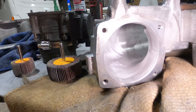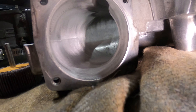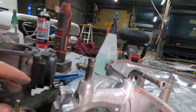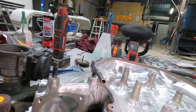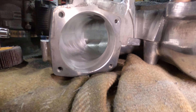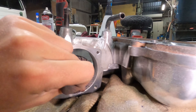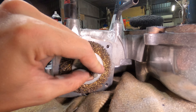There's a little cast line on the left side of that throttle body — it's upside down so it's actually the right side — and that's what I'm trying to work on right now. The rest of it is getting pretty smooth, barely any casting bits left. It's definitely worth looking into flapper wheels for this. For the throttle body neck and intake plenum, which is 70mm, aim for something around 60 or 65mm — this one here is 60. The 75mm wire wheel just doesn't fit, so keep that in mind when buying your tools.